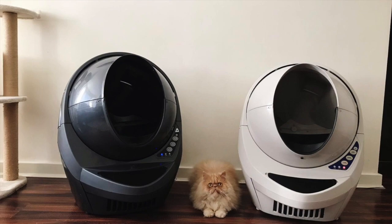It did happen a number of times. I discussed this in a previous video and I spoke to Litter Robot directly about it. What I did to stop this happening was I basically took the dome off and cleaned the contact areas where the sensors are. I also made sure the Litter Robot was on a perfectly flat surface, because where I had it originally it was on a lino-type floor at the edge of the room where the lino kind of bubbled up, so it wasn't perfectly flat.